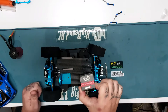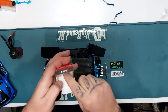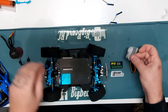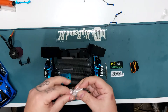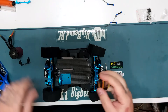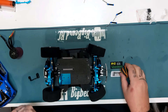Going to fit the E-Max ES3054 servo — this is what I fit into all my 144001s. It comes with an array of connections. The only one I've found that works is this one, and I cut three of the ends off and used the one and rounded it off. Been using it like that for a while in one of my 144s and it's been brilliant. I do recommend them, I think they're brilliant.